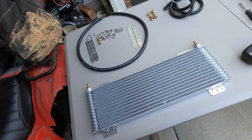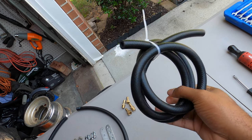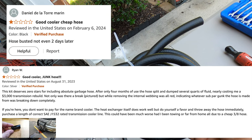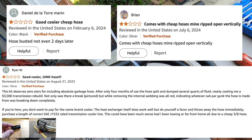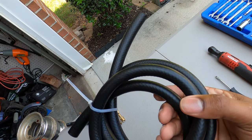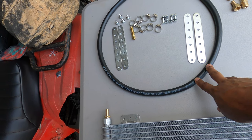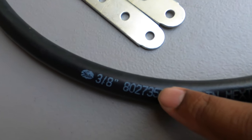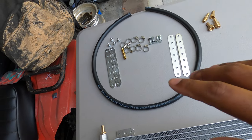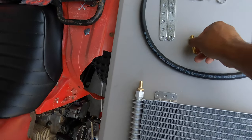One thing to know about this kit from the reviews is that the transmission cooler hose that comes with it is apparently trash. I read maybe five reviews of people who used the included transmission hose and they say it bursts. Two of them said it burst, they didn't know it burst, all the transmission fluid came out and destroyed the transmission. So I'd much rather spend $20 on this Gates transmission hose, Gates number 802-7357 — I think it's four feet of hose.